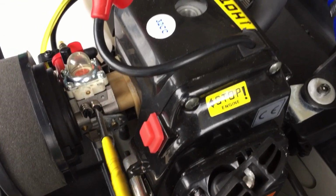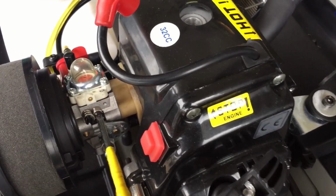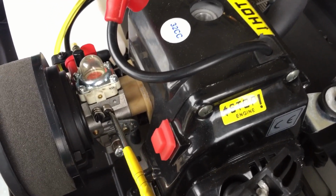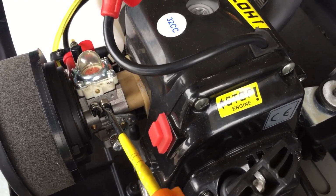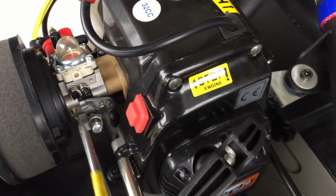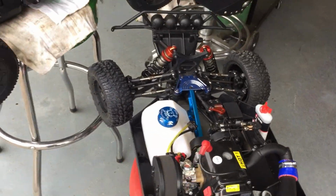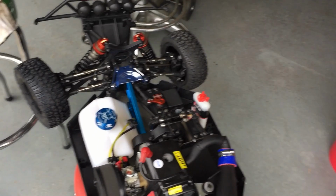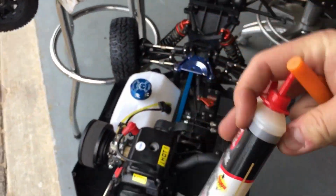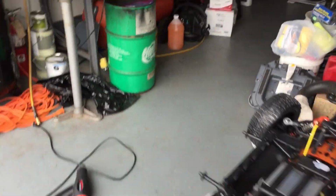Okay, low speed, we're gonna go 1.25. Close it up, right? We're gonna go half. It's one full turn, then quarter. Copy that? Okay, now carb is set. We got oil in the motor. She's working, she's saturating. She's doing her job in the metals, right?